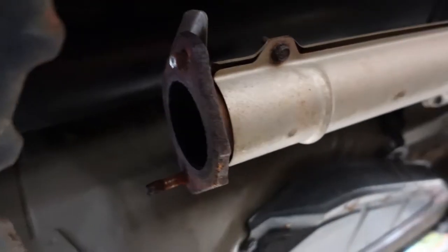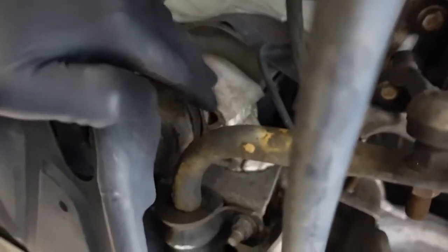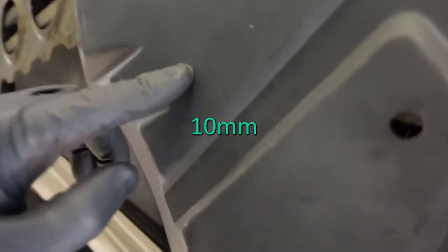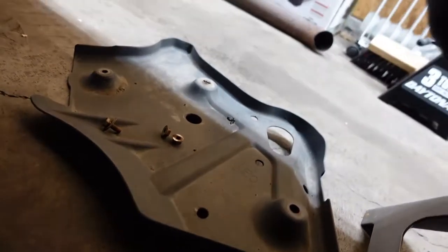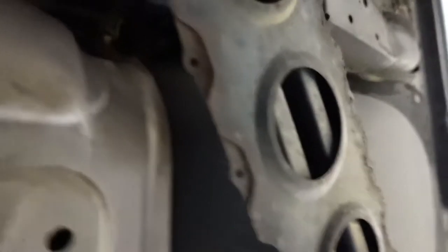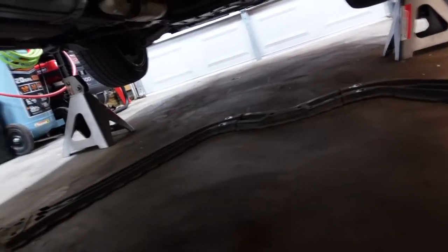Here's what it looks like in the car. I'm okay with it because I wanted to get a different Y pipe and exhaust for this car anyway. I showed where some of the collars are going to go at the back of the rear subframe, and the others go up front. The next thing is to remove these covers. I also have to remove the covers on each side — left and right. These are little plastic covers that cover what they call the W brace, because it's shaped like a W. I finished unbolting the W brace without any trouble, and you can see how removing it first gives more room for working on the exhaust.